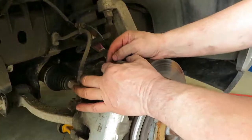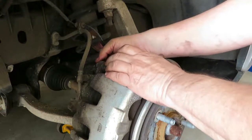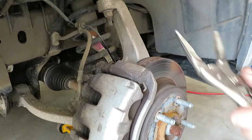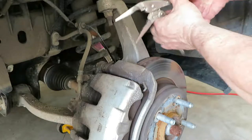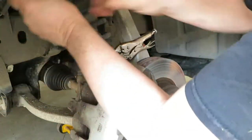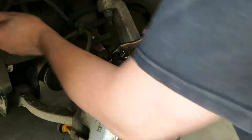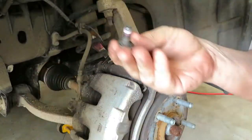These have a kind of two-sided head on it — there's a bolt head on the inside of the caliper and then the bolt head of the actual bolt holding the caliper on. So what I use is a pair of thin, pointy needle nose pliers just to get it on that inside bolt and hold that firm, and then you can get the bolt out quite easily after that.